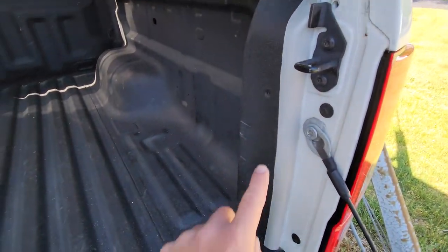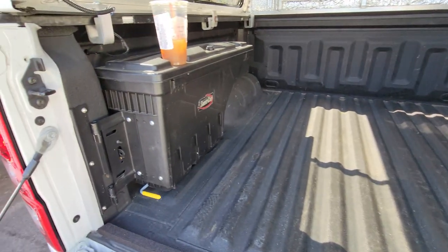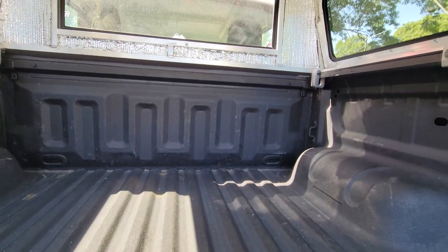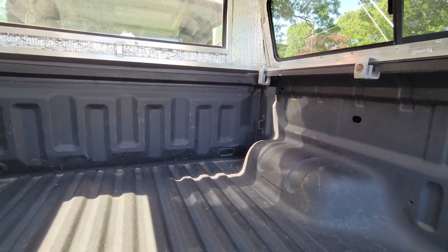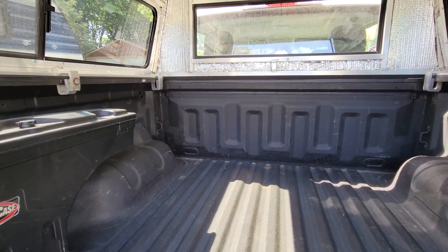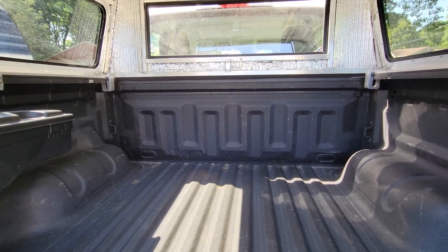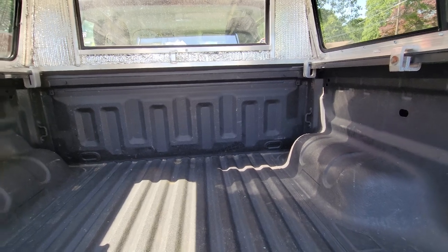And I also placed this camper shell gasket on the side here. I don't have high hopes for that sticking because I forgot to clean the surface, but I can always reapply. So we should be pretty well sealed up. I took great effort up front. I actually had to remove the cap and seal it correctly because the installer, the dealer, did such a terrible job. There was no front rail seal in there. There was just a metal trim piece covering it, and a little bit of foam and probably a tube and a half of black silicone all over my truck.